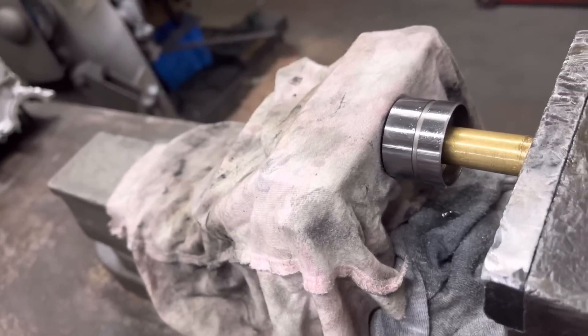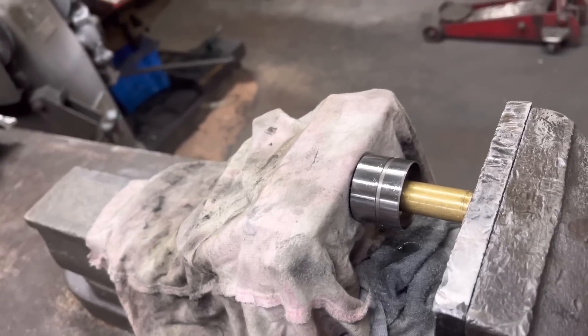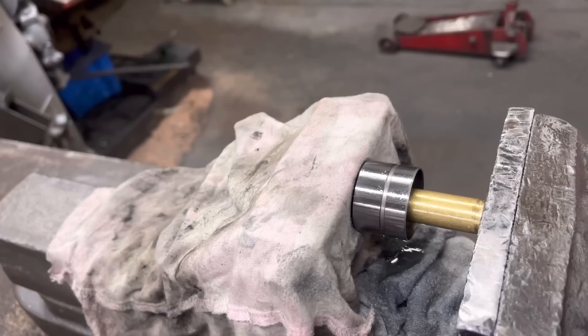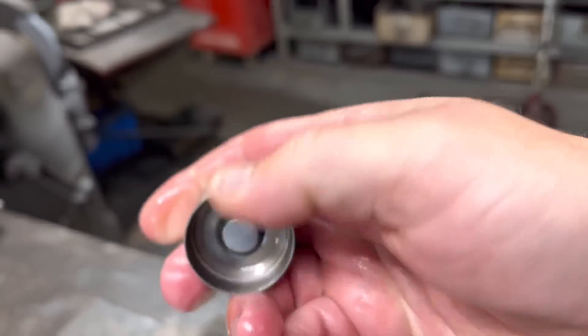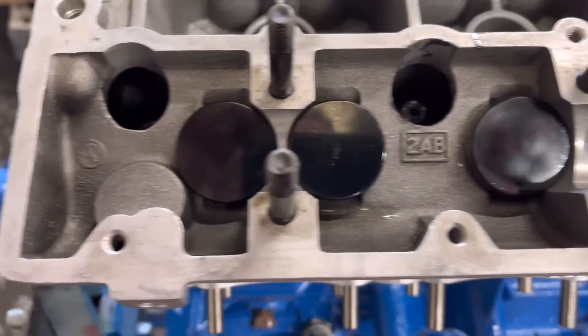Then backwards, then forwards again until it stops and back out. See that - nice flow of fluid there. It's surprising how much fluid they hold. What happens is you find there's no resistance now going in and out, so that's just working off the spring. That's just nice and squidgy - that's perfect for going in. So we give that a good clean, oil it up with the oil we're going to use in the head and we'll pop that in. Now I know quite a lot of you are going to say you can't believe I've put something that's going to go in that engine into that vice and used it like that. But we've done it loads and loads of times before - we've got the aluminium jaw in there, we've got some cloth, it doesn't damage it whatsoever. I've done eight here and you can see on the top it's perfectly perfect.